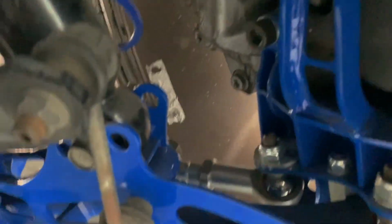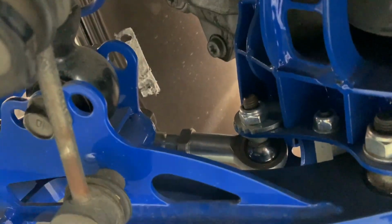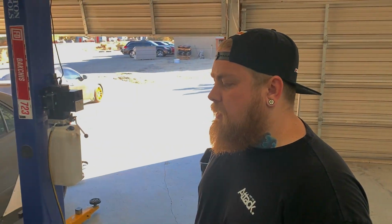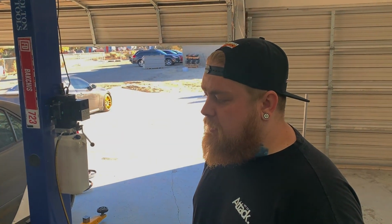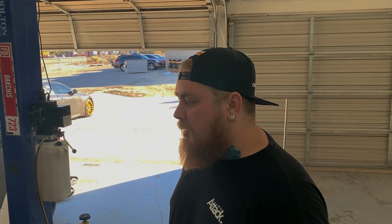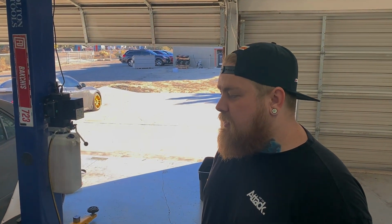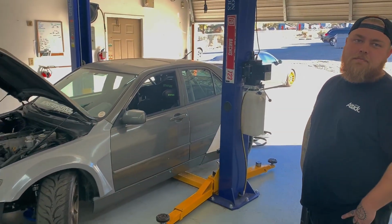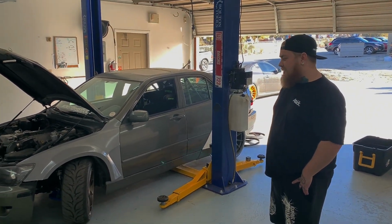Rear rack, that's obviously not my favorite, as you all know, but it has the standard Wisefab Ackerman adjustment that you guys all know from the S chassis and the E90. That's one of the nice things about this kit over some of the other lock kits for the chassis, is they all have offset spacers. Right. I've been told on this chassis it's not a big deal, but I remember S chassis and Z chassis, people breaking them, or tie rods. You know, well, it's not ideal. People ask, why do you guys run the offset spacer? Like, yeah, we don't want that. You know, it's just what we get from the factory.